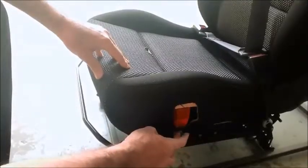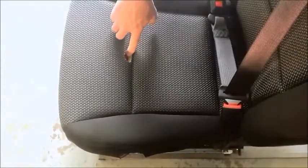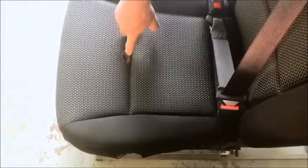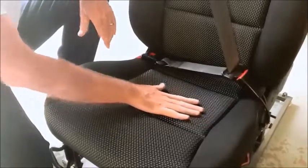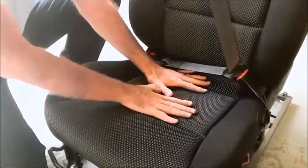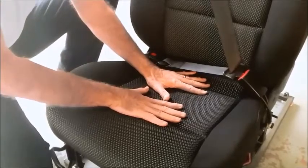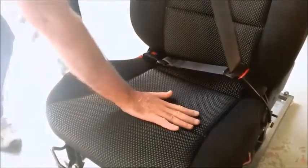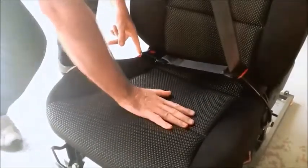This is the fixed point on the left-hand side of the seat. You can see here the red webbing running along underneath the seat foam, about one inch below the surface. With a normal seat, the occupant needs to compress the seat foam by about three to four inches before they engage with the anti-submarining pan. But with Lifebelt, a simple push at the front of the seat reacts immediately to tension in the lapbelt.